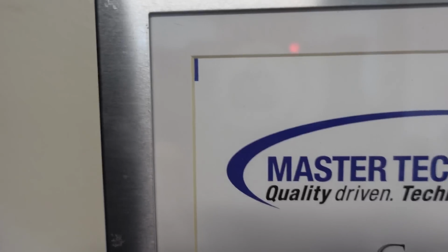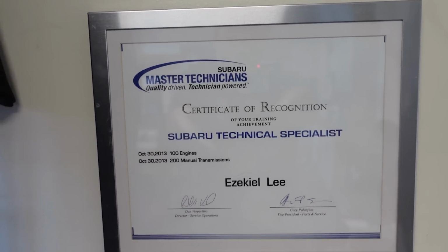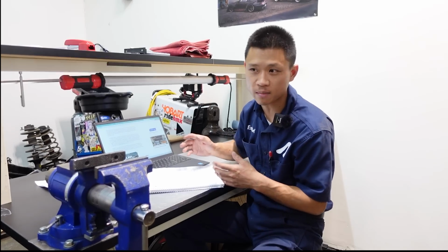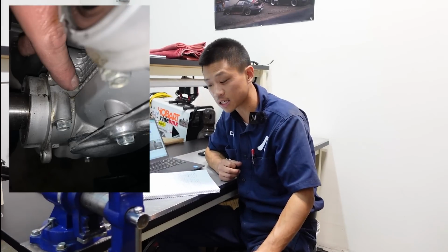Let me give you guys some of my experience and thoughts as a former Subaru technician. So all the way back in the day, I was a Subaru dealer tech before the 2012 model year FRS came out. So I saw when they switched over to all the chain engines with the Imprezas, saw when the FRS came out, saw all the problems with the 13, saw the 14 come out, blah, blah, blah. I've seen it. Way back in the day when those chain engines came out, the FB engines in the Impreza, the cam carriers always leaked. And then the Outback with the H6 engine, those timing covers always leaked.